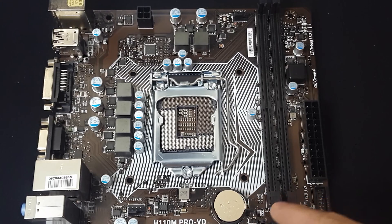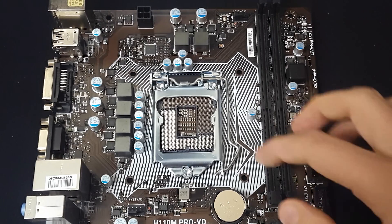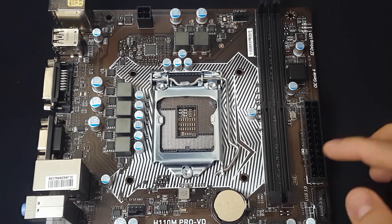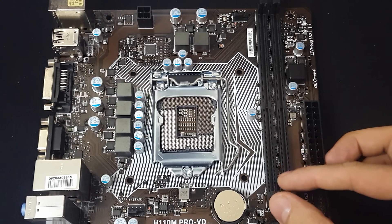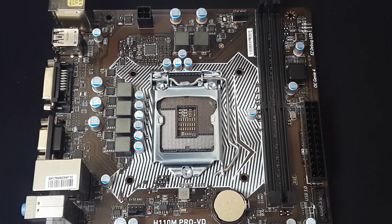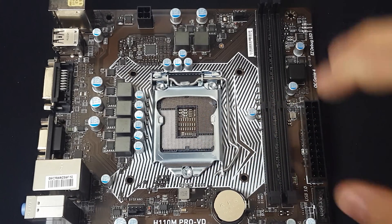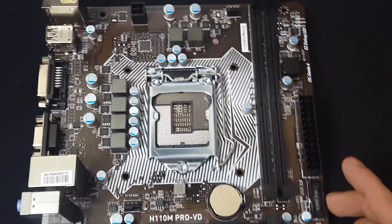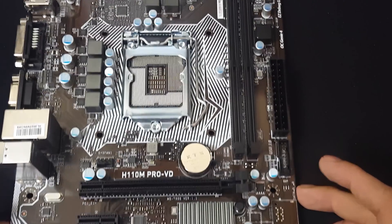It does bug me that with small motherboards you only get two fan headers — I think all motherboards should come with at least three. We have the CMOS battery here and a clear CMOS jumper which you'll see when I show the bottom of the board. The socket is LGA 1151, supporting 6th generation Skylake and 7th generation Kaby Lake as mentioned. We have two DDR4 slots rated up to 2133MHz and you can go up to 32GB — two 16GB sticks — though honestly I wouldn't put more than 16GB in here. We also have the 24-pin power connector and the USB 3.0 header.